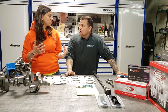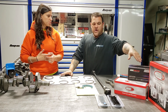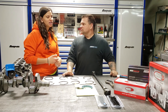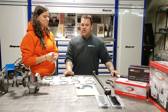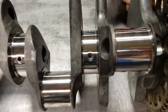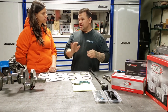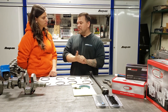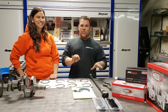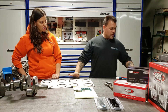At worst case I'd use a whole shell, but because we're using quality parts you don't run into much variation. We already mic'd the mains and the crank didn't vary one bit, so I'm sure the rods all the way down are going to be exactly the same. The Callie's product is so on point when it comes to grinding, and with the bearings, the thickness used to be an issue years ago. King has solved all that — the coating is on point and the clearance and thickness of the bearing is almost perfect. For most applications it's perfect, though you can always be better.